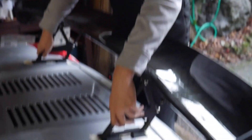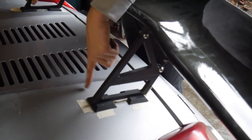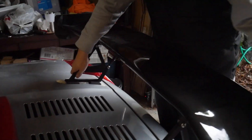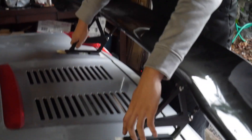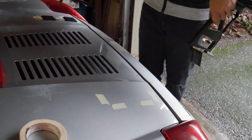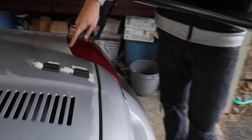What we did is these come with stands, so we measured from right here to the center, out to the back of the trunk lid — we measured all the distances. We taped the edges of the stands, so when we pull it off and the stands are left, we can find the holes right there, punch through, and know it's lined up.